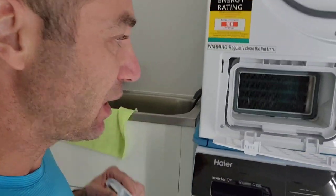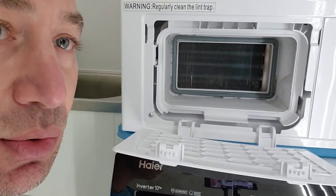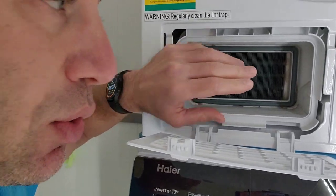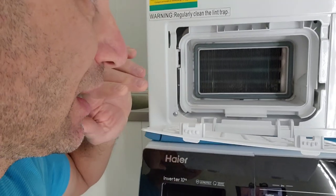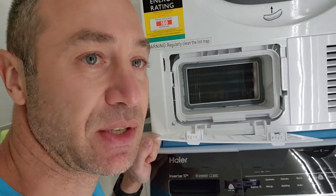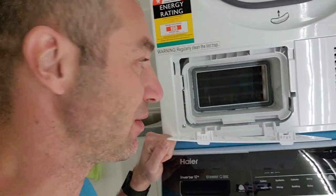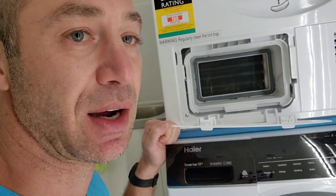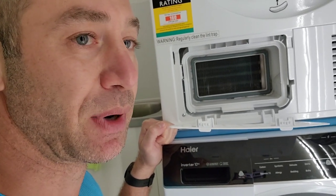The reason it's important is because this dryer is kind of a reverse air conditioner. And as you can see here, there is a heat sink in here, and all the dust — if you don't clean — gets sucked in. I almost guarantee you, if you don't clean that heat sink and it gets clogged, your dryer either won't perform or will break down.